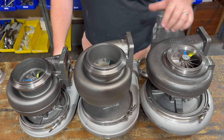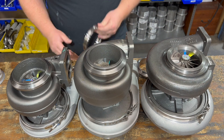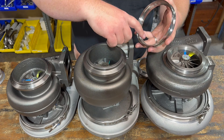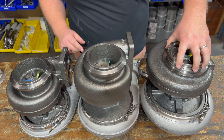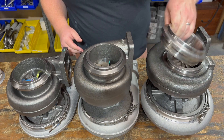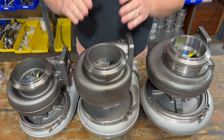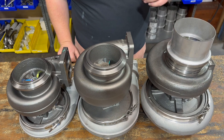The problem comes in on the S500 — the flange is completely different, a 5.16 inch flat face V-band. You have two options: first, get an adapter that bolts directly to the turbo, then cut the flange off your existing downpipe, fit the pipe into the recess, and weld it up as your new flange. Or, if you don't have time to weld, use a trick adapter where one side mates to the 5.16 inch flat face V-band and the other side is your 5.75 Marmon — making it identical to the S410 and S400 so your stock downpipe mates directly with the S500.